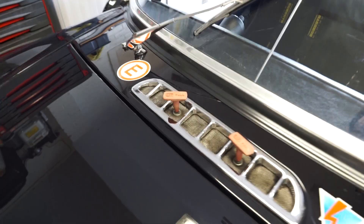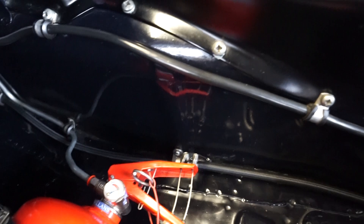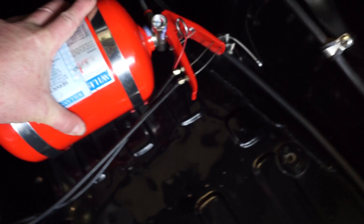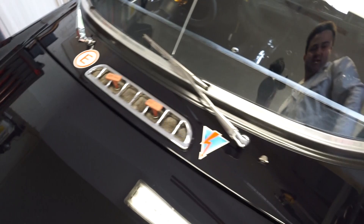Alongside the electrical cutoff we've got the fire extinguisher cable here - that just pulls up a little bit. What I've got on the extinguisher is two little springs so that the scrutineer can see that the cable is working freely. Your fire extinguisher should be fully charged and securely attached to the floor of the car. The scrutineer did mention they prefer them at the side of the car rather than in the middle, because they wouldn't be easy to get to if the car was on its roof.